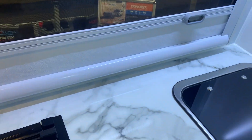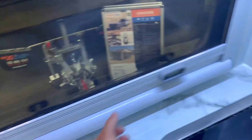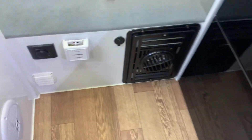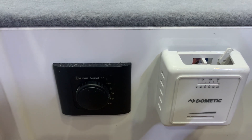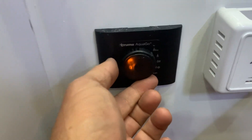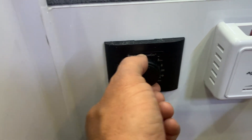The shades here are dual purpose. You pull up and you have your shade; go down and you have your screen; or you can open them all the way up. Got a wardrobe in here with more storage. There's your propane heater with your thermostat there. For the water heater: you have the switch on the outside on the water heater — always leave that on — then you would turn your toggle switch on for water heater up front, select your different mode, and when that light's on it means your water heater is active. You can hear it kicking in out there.